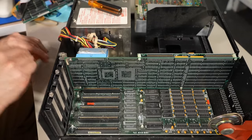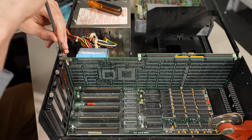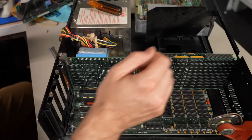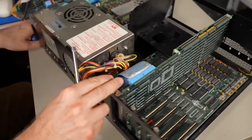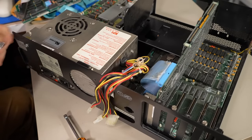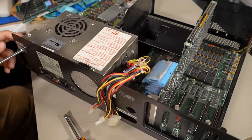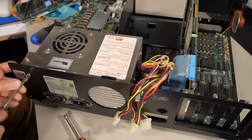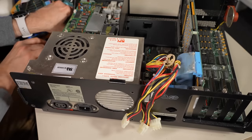But this card right here is the one I want to see. For ease of removal, I'm going to get the power supply out of here — it only has one screw. I wonder why the other screws don't line up — oh wait, they do line up. Maybe this thing was just thrown together at some point. You take the screws out and push it forward, then lift it up and unplug it.